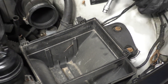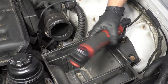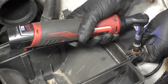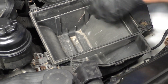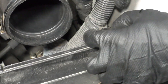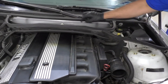I'm going to take these two bolts out using a 10 millimeter socket, extension, and an electric ratchet. You can use a regular ratchet if you don't have an electric one. Loosen them up and take them out. Now just grab the airbox and slide it up. This wire is on this little grommet right here — just try to slide that out. Take that off and just slide this out of the way.